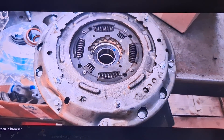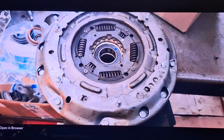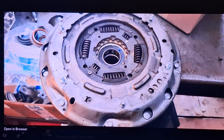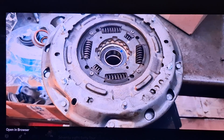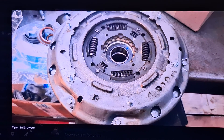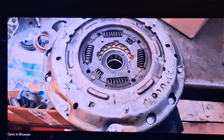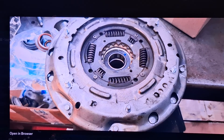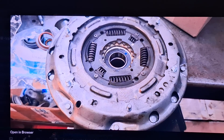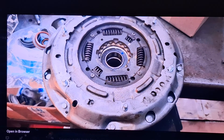If you've got mechanical clutch codes saying the clutch is stuck applied or has performance issues with applying, but your clutch fork feels fine, you don't have any electrical codes for the TCM actuator, and you swapped the actuators and it didn't transfer, then you likely have a slave cylinder where the bearing has come apart and it's locking up on the guide tube, causing the clutch to stick. When in doubt and you're capable, pull the transmission and check — especially if the apply components haven't been replaced in over 50,000 to 100,000 miles.